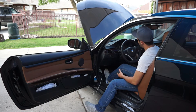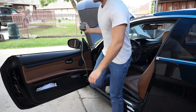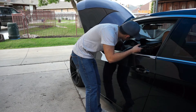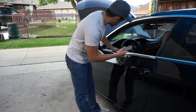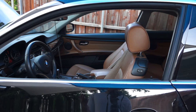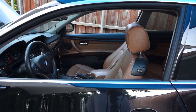With your key, you're going to get out of the car before you click the start button — with the phone hopefully with you or at least accessible. Close the door, press the start/stop button once to get your ignition on. I have my windows open because once you get this flash started you can't open the doors, you can't close the doors. It's a pretty important process — don't open the trunk, don't close the hood. Just let it be and access anything from the car through the window.